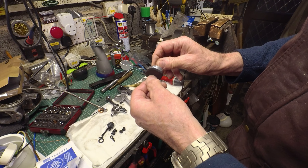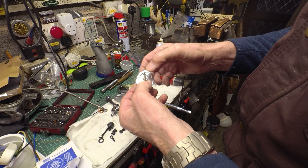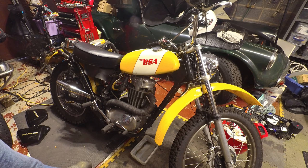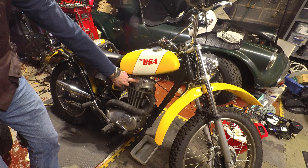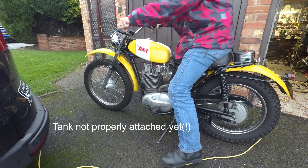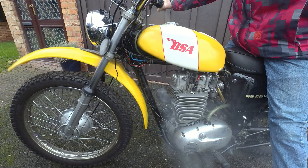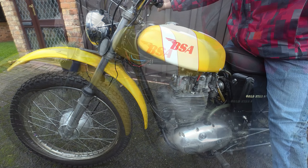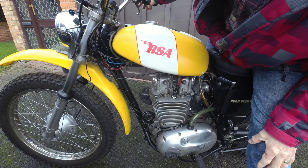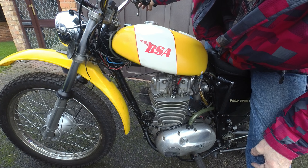So that foam is now stuck on the back — just plug the screw through, so there'll be a seal on that thread as well, slightly at least. So all back together apart from the side panels — I'll put those on later once I've got it started and checked there aren't any oil leaks. The little PES cap is on with its neoprene flat sheet seal — see how that works out. I just burned off the oil that had got onto the wrap on the exhaust. So far so good. I'll take it out for a run, get it properly hot, and hopefully that's fixed the leak — but we'll see. Thanks for watching.